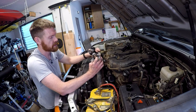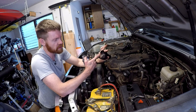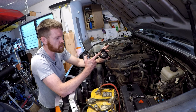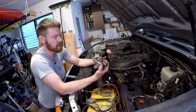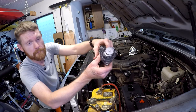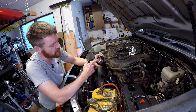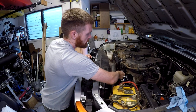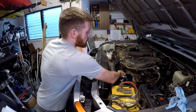I want the thermostat to be as close to the OEM one as possible, so I'm going to drill a tiny hole in the top of this thermostat. There's no little bypass hole where the jiggly valve would be — no little hole to pass air bubbles through. So I'm going to pull out the thermostat and drill a little hole there. Looking at the stock setup, there's a hole in the very top of the thermostat and it actually has a little jiggly valve in there. I drilled a little hole in the very top — it doesn't do much because of where the housing is, it actually kind of blocks the hole.